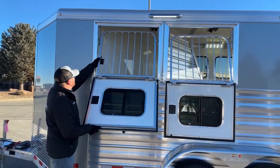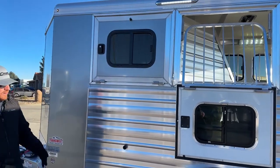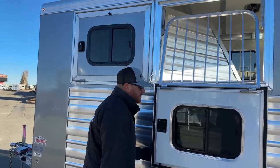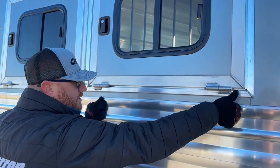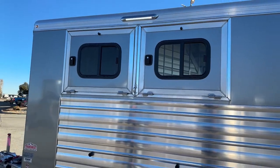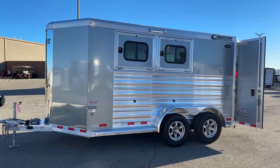The drop windows have jail bars — you just lift up and there's a little sweet spot that sets into the track. From the window to the edge, that's all framework, so they are extremely heavy duty and going to hold up over time. We use these windows and doors every time we use the trailer, so we want them to withstand general usage. Welded hinges with grease zerks as well — there's a brass rod in the middle with a groove cut into it, so when you start putting grease to either end and opening and closing it, it forces that grease throughout the entire hinge. The 16-inch awning light on the driver's side looks great, and everything is on an individual switch — so you can do either side, the rear, the stall lights, any of them on an individual switch.